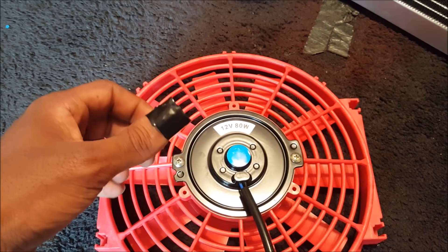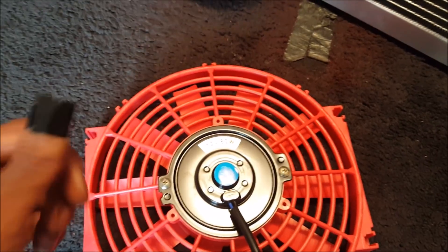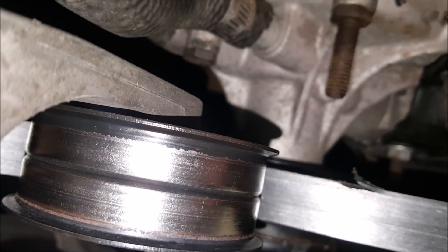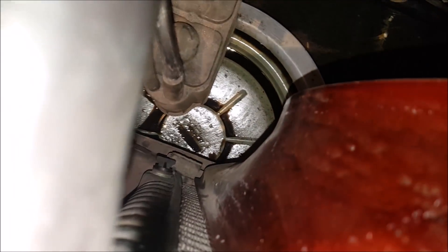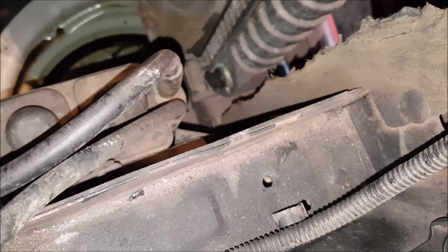Don't mind the thumb — I actually ripped my fingernail off messing with vacuum lines in this car, so be careful. Before you go and take any belts off, you want to break these bolts loose — these bolts connect the fan and the pulley. First thing we're going to do is take these bolts off the tensioner and get those nice and loose. All four bolts are loose. Before we go any further, we're going to go ahead and take out the drain plug and drain out the radiator fluid. Make sure you don't do this on a hot car because you don't want to burn yourself or cause your radiator to explode in your face.